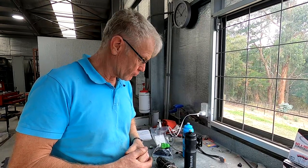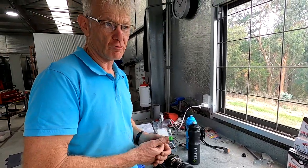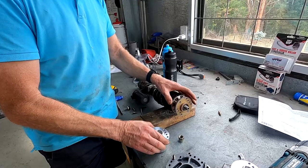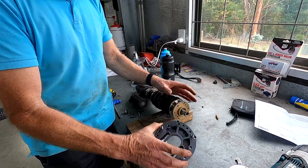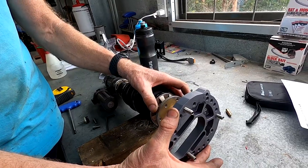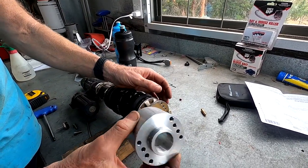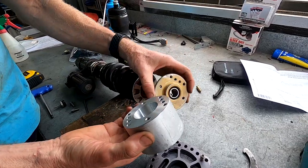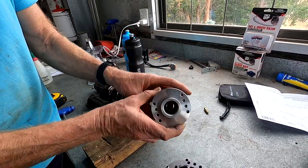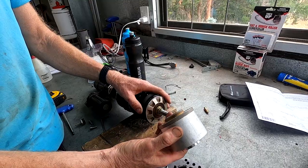Tate talked to you about the issue with the lack of droop. While this strut has adjustability of height, it's already gone as far as we can with trying to drop it and it's still not far enough. The only way is to actually lower the whole strut. Normally this nut holds it and the SLR goes on under the strut tower — what we've got to do is space this out, which will drop the whole assembly 50mm and give us 50mm more droop. I've made up this spacer — one for either side with two extra holes — so they marry together and we've still got all the same adjustment bolts for the SLR setup. It'll make the strut 50mm lower in the car, which will do the trick.